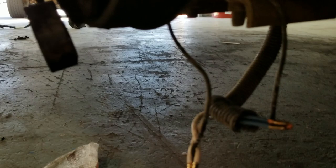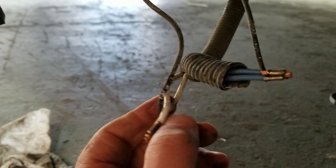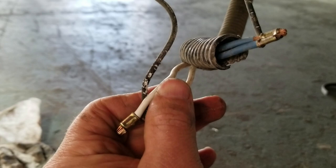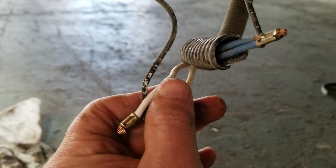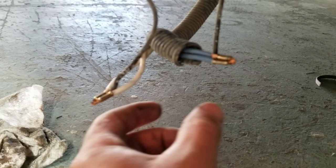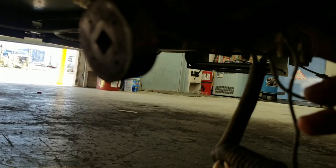We're at the juncture now of the trailer wiring forward — between the hitch and here — and this one's brake solenoid, and t'other brake solenoid. The trouble with troubleshooting is it's always the last thing that you fixed that fixes the problem. To the trained eye, this is probably where I should have started. However, when you're troubleshooting, you don't necessarily know the system. The near solenoid we got 4.2 ohms, and the far solenoid we got 4.2 ohms.